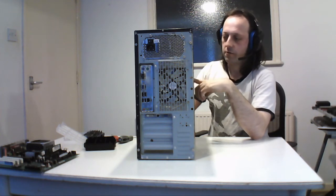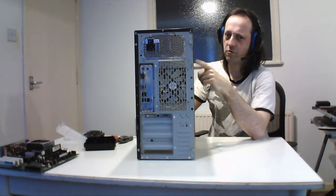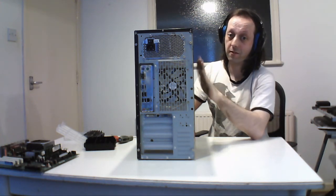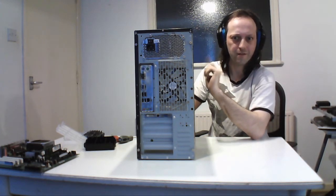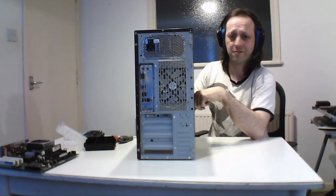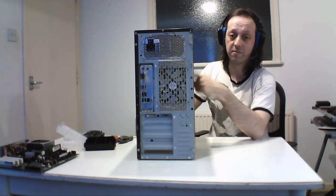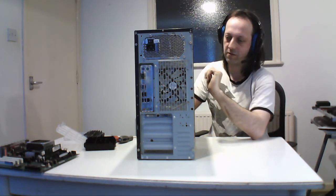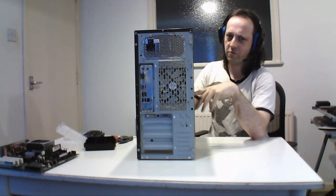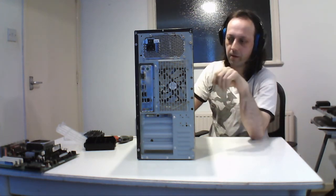Because this one's also got 4 gigs of RAM, Athlon 64 X2, so it's a 2.2 dual core, 64-bit, so it's all 64-bit and a good GPU. So this is handy for that type of testing. With this, I don't worry about buggering the drive because I can just wipe it and start again. But also, this machine is for testing other drives that come in because this has both an IDE and a SATA controller, so it has all the benefits of doing standard stuff. And if you need to copy drives, you can run it on this without occupying my main system.